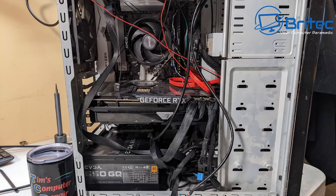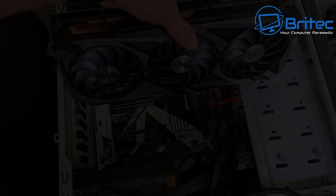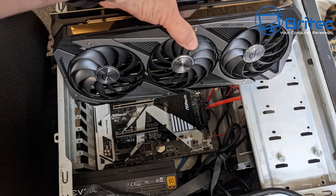This is the first computer and you might be thinking that's not too bad, but once you start digging deep you'll see some really bad mistakes. I'd go as far to say it's probably the worst computer build I've ever seen. These are 3080 Ti and 3090 Ti graphics cards with high-spec motherboards, RAM, and power supplies. There's hardly any screws in the motherboard, the motherboard is not in situ correctly, and there are thumb screws holding the hard drive in.